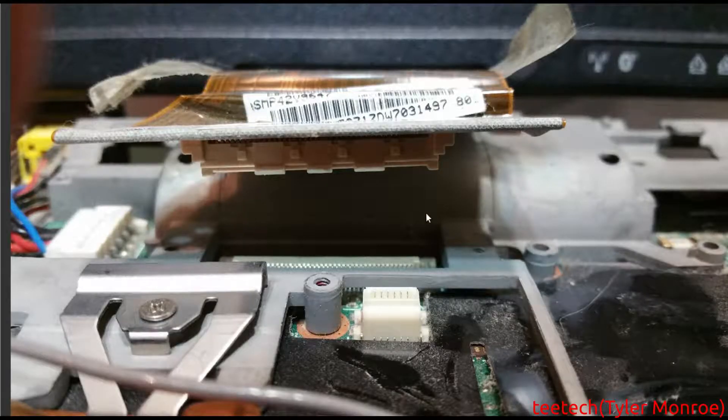By taking the Wi-Fi card out, you loosen one of the screws for the bracket that holds down the display cable for the LCD. There's one more on the other side — you just take them out, and then the cable pulls up and out of there. Be very gentle with these cables because they're very fragile, and the pins as well.